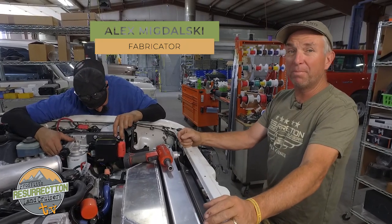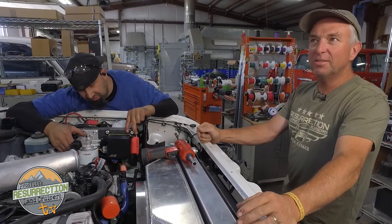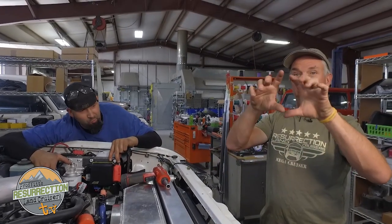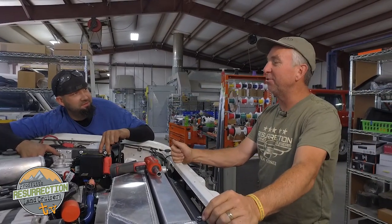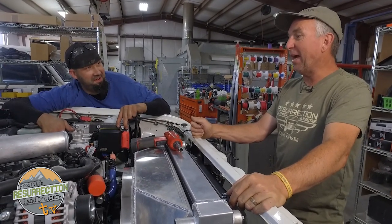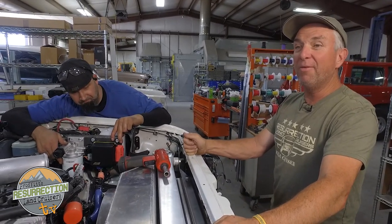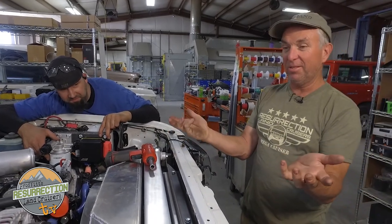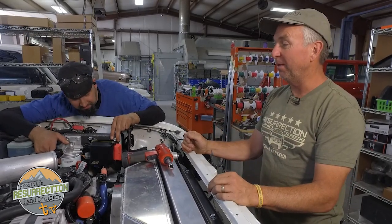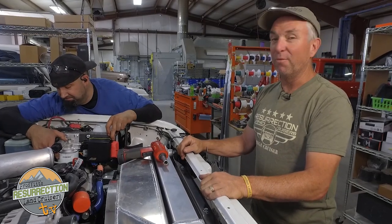This part is so bad it's below the board parts in the scrap metal bin. I'm talking about the propeller — the transfer-case-mounted engine conversion bracket that looks like an airplane propeller and bolts to the back of a three-speed or four-speed Land Cruiser transfer case. People are still using those. They crack your transfer case, don't have enough isolation, and cause a bunch of vibration. There are a hundred better ways to do it. If you have one of those big heavy 3/8-inch-thick propellers and you're getting ready to do an engine swap, stop it.